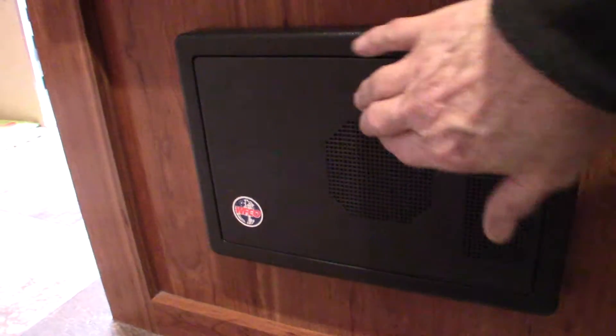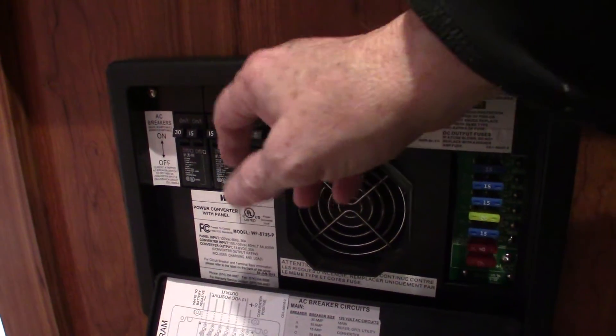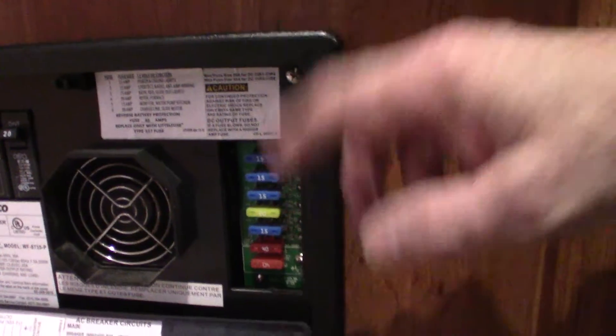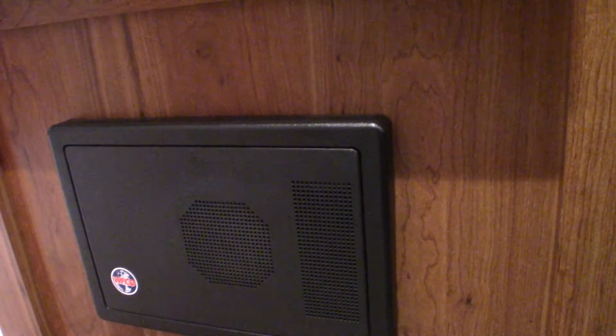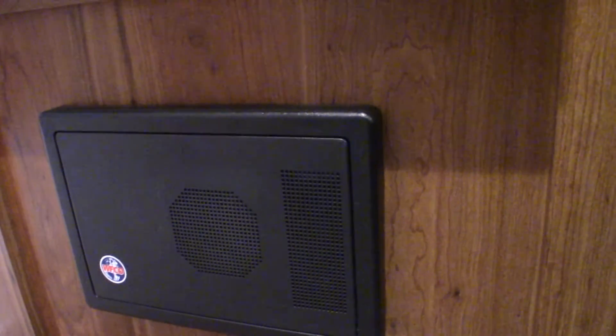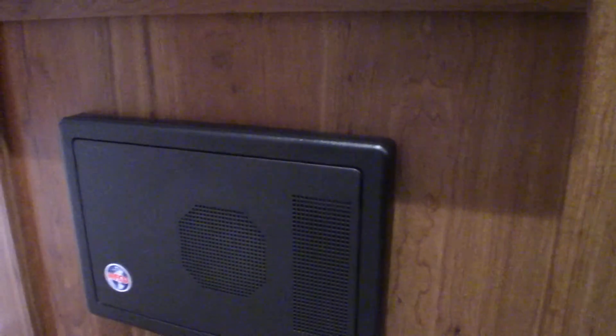This device right here is your power converter. It converts AC to DC power. When you're plugged into shore power, it has circuit breakers right here — just like you'd see at home — they're 110 AC and they're labeled. Over here the power is converted to 12-volt DC, so you've got 12-volt fuses here and they're labeled. This is also a battery tender — as long as you're plugged in, it'll sense how much energy your battery needs and send power accordingly. If it's topped off, it'll just trickle a couple amps; if it's low, it'll send 10 amps or whatever it needs to keep your battery charged. When you're pulling this down the road, the alternator will send power through the charge line to your battery and charge it as you go.